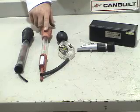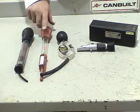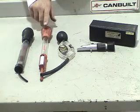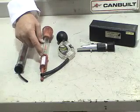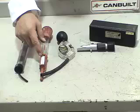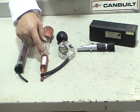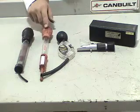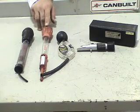The second type performs the same function except it uses a little bulb inside that floats up inside the electrolyte, but it also comes equipped with a thermometer. That thermometer is used to determine the actual temperature of the electrolyte and the environment around it, because specific gravity testing is based upon 80 degrees Fahrenheit.